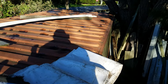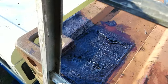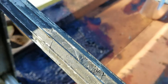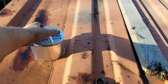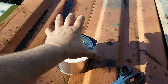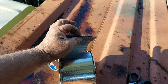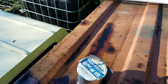I've dealt with quite a lot down this end and I'm now back up here. Not so many holes up here, but these patches were put down over something that was already rusted, and even though they seemed welded all the way around, water has got in and rusted between the two layers of metal. I've put the rust killer on. For the actual holes I've been fixing with flashing tape — this is for around house windows, used inside walls during construction. It's a bitumen, thick, tarry, incredibly sticky, strong waterproof tape. It can be used for so many things and it's relatively cheap.